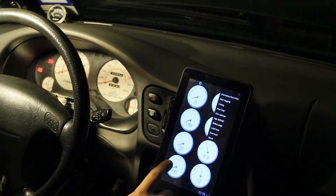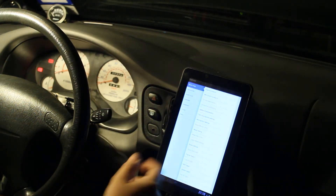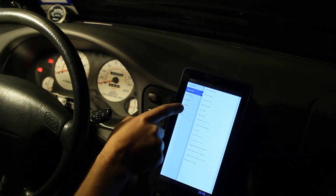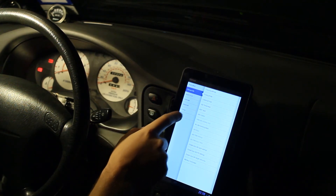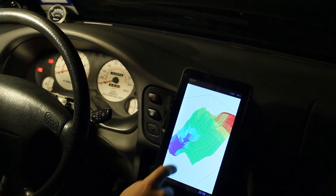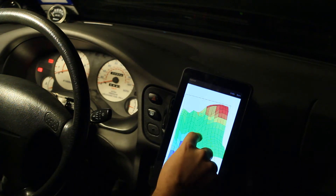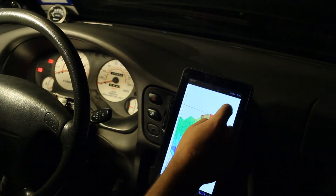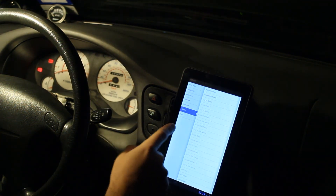What's really nice about MS Droid is that it'll actually let you do some tuning — logging and everything. You can go through and do your normal tuning: idle control, idle cranking steps. Here's the actual fuel table — 3D and everything. I'm not sure if I can make changes here, but I was looking at it in 2D earlier.